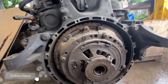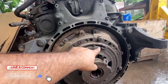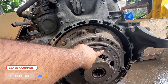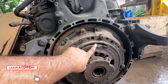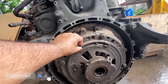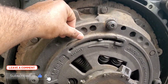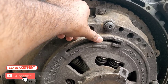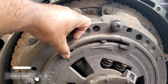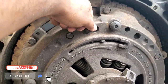On the front of this, as you can see, there is a small line right here that indicates high or low. On one side it says you need to replace, and on the other side it says the clutch is new. Right here you can see this thing is sticking out — that shows the level of the clutch. If it's all the way down, the clutch needs to be replaced; if it's all the way up, it's brand new. On this one you can see it's right above the half, so it still has life left. You can go under your truck, look at this level, and tell exactly if your clutch needs to be replaced.